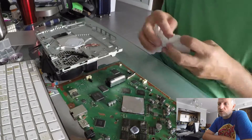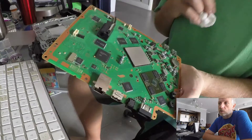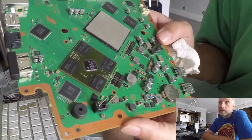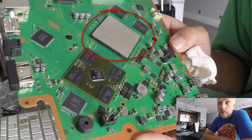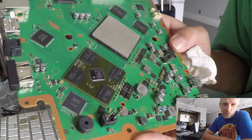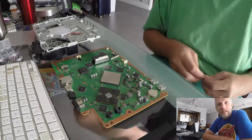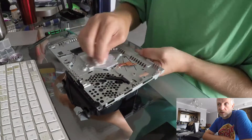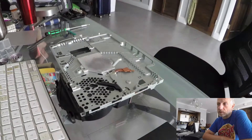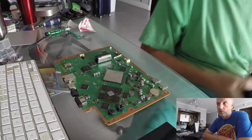The second pressure plate is removed revealing the logic board — there's the bottom and there's the top. At the other part of the heatsink you can see all the really dried-out paste. I'm removing that first with a piece of kitchen towel, then using an alcohol wipe to get all the residue off. At the top is the big silver thing — that's the Cell CPU that Sony developed. At the bottom, the tiny black thing with the PlayStation logo — that's the RSX Reality Synthesizer, basically the GPU. There are two types of dust: one easily blown or hoovered off, and one so fine you need to wipe it off with kitchen towel.